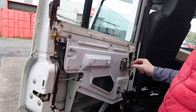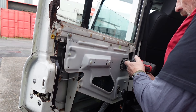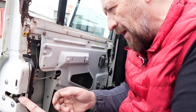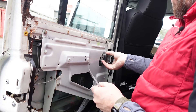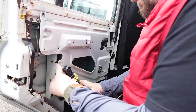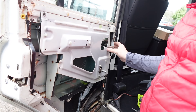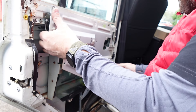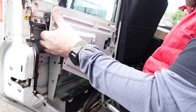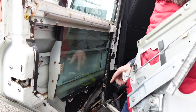We've left our two clips on our L-brackets. Next we've got to release our door latch, which is attached to our lock mechanism at the end of the door. Pop it out and this should be free. We've got one more at the bottom and also one on the side on the bracket. You might find that once you've released this you need to wind the regulator up again because there's a little cog tooth that gets in the way of removing it from the bracket at the bottom. So we've got our regulator off.